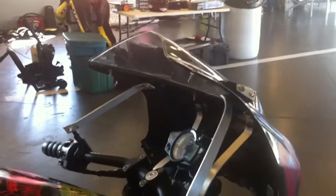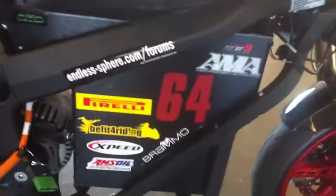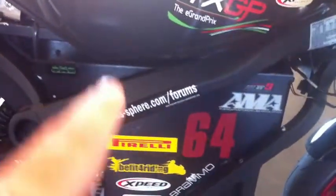Aerodynamics above 80 miles an hour is key. The whole reason I even started to put this fairing on was to extend the range. Typically at 70 miles an hour the range is about 60 miles. With the fairing on there, it bumped it up about 7 to 10 miles at 70 miles an hour. Terry normally rides with four chargers mounted to the frame — one underneath, one on each side, and one under a tank bag — giving him charging at 4 kilowatts versus the stock 1 kilowatt.